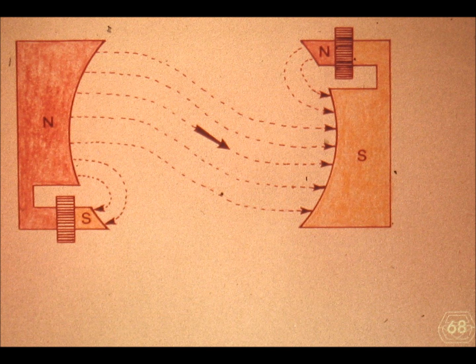Slide number 68. Shaded pole motors can be constructed to rotate either clockwise or counterclockwise by properly placing the shaded pole coils. Shaded pole motors are single-phase motors which contain divided stator poles. The coils of the shaded poles develop an axis which differs from the axis of the main poles.